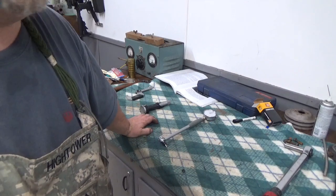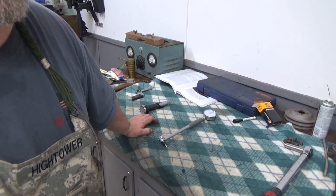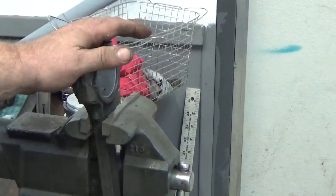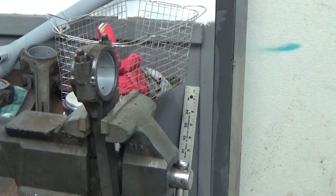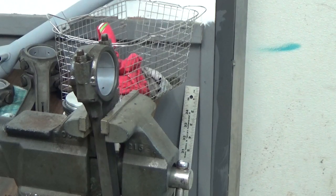We'll move on to the next set. Everything is set up so we can move through this, and we'll end up back at the whiteboard again. I'm going to show how to measure and how it all works. I've got the rod set up with the bearing insert inside, torqued to specification. The rods have been straightened and honed to specification. It's just lightly in the vise — just enough to hold it so I can get the dial bore gauge in there.